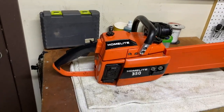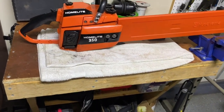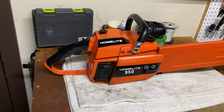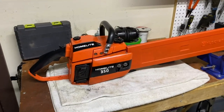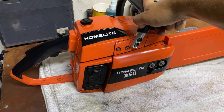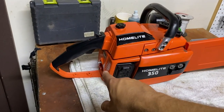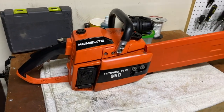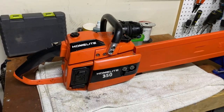I had a lot of problems with that thing, like I'm running into with this. It's just old - just old crap showing its age. You just have to run it and see what breaks, then fix it as you go along. Luckily nothing super serious - the compression was awesome. It was flooding, and I was able to kind of lean it out; I just couldn't get a good mix on it with that transformer kind of coming off at the end. But I really think somewhere around that half turn, we're going to be at least getting her going.